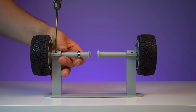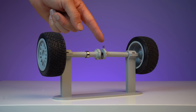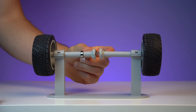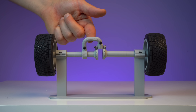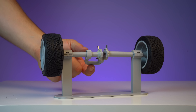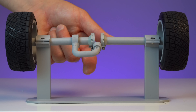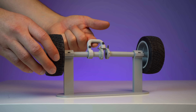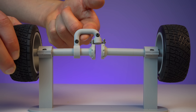Let's fasten a spoke on the inner end of each axle so that by turning the spokes we can turn each wheel separately. By adding a crosspiece we can turn the wheels in the same direction at the same speed. Now let's add something that holds that crossbar in place so it can press against both spokes simultaneously — it's not locked to the axle so it can rotate independently. We can spin the wheels by rotating the support, which is fine as long as both wheels turn at the same speed. But when we try to go around a corner, we can't drive one wheel faster than the other — if we stop one wheel, the other one's not moving.